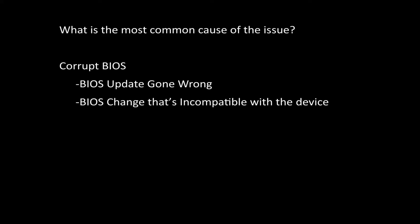There are a few things that will cause your GPD Win to become a brick, but the most common reason is a corrupt BIOS. This can happen when you try to update the BIOS and something goes wrong. We've even heard of others just making a single change in the BIOS itself and that causing a problem.